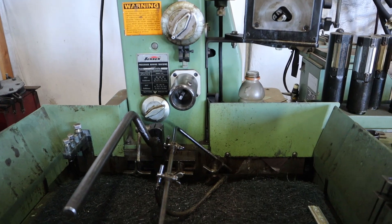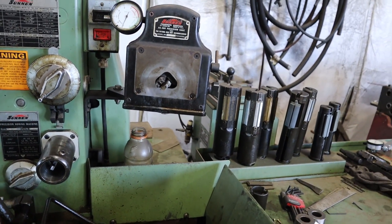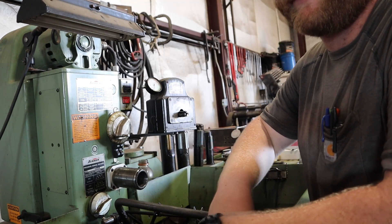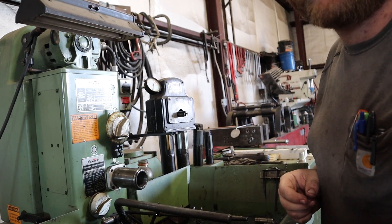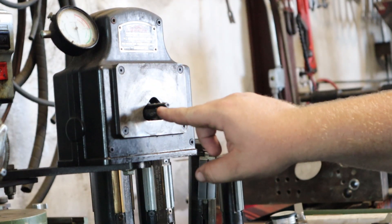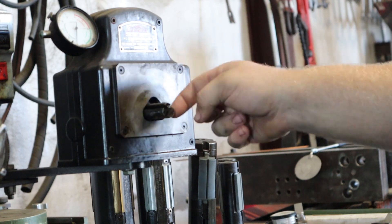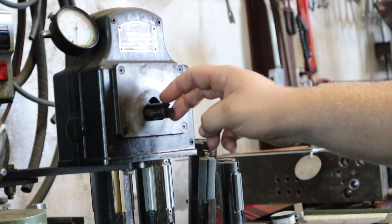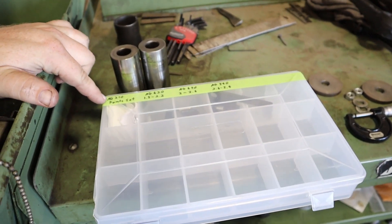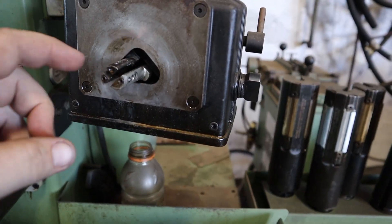CDP Performance asked me to give a video on how this works and how to set this up. I'm set up at my table with my connecting rods. The gauge has fingers - this one moves the gauge indicator - and it's got small points with little ball bearings that make it easy to ride on so you get no friction as you take the measurement. Here are the part numbers if you need to buy these.